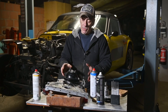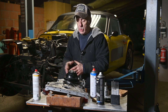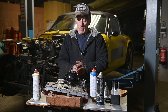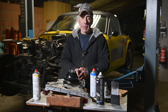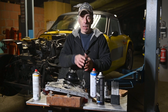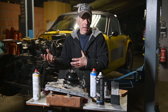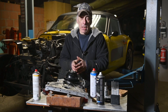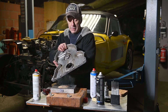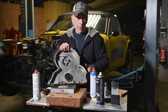The cover is about ready to go back on. First I'm going to clean it up on the outside and give it some fresh paint, let it dry, and then put it back on the engine block. The sequence of installing is exactly the reverse of removal: first put on the timing cover and install all the bolts, then install the fuel pump, then go back to the bottom pulley and put it back on the crankshaft, then put the sump back up. The main thing to watch out for is cleaning up the edges very nicely, removing all excess silicone or old sealing material, degreasing everything, and then putting the new seal in.